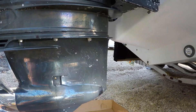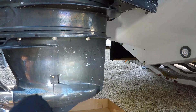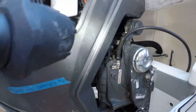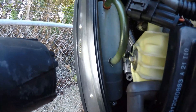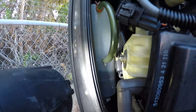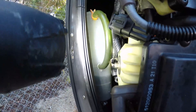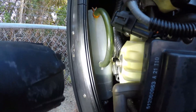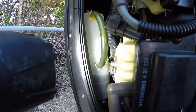Like most of them, what it actually has is you've got your drain plug, fill plug, and then there's actually a tube that runs all the way up the motor into this little ketchup-looking bottle. It lets you make sure that your lower unit or gear case still has oil in it, and it actually gives it some room to expand. So if you are having issues with your gear cases, instead of it just getting hot and blowing out the seal, it gives it some room to expand.